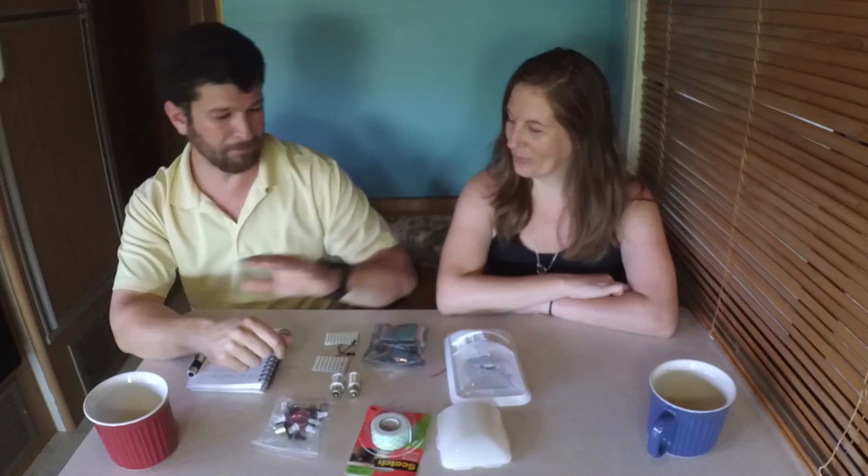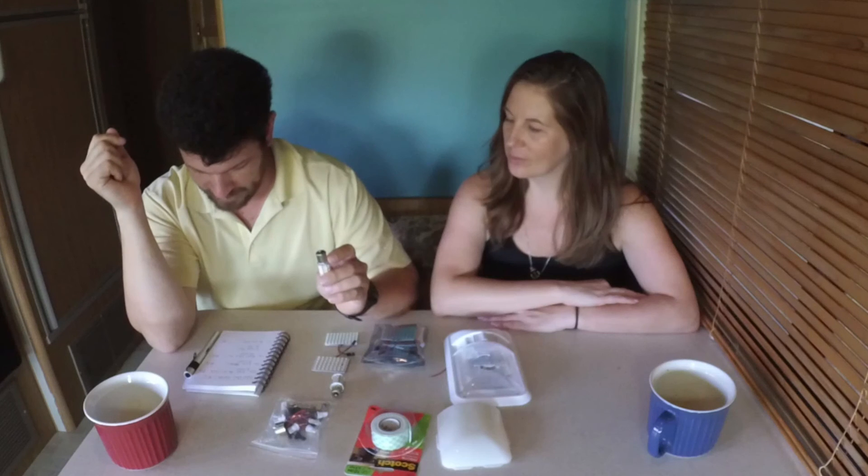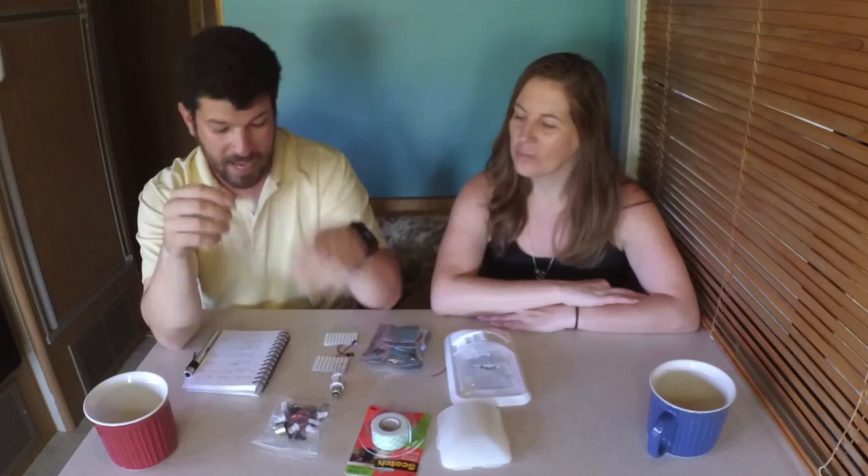Anyways, back to the beginning. When we got Barry, I decided to change up to LED bulbs. Barry's internal roof lighting uses bulbs called a BA15s, also known as an 1156 bulb, which means it's got a single electrode at the end with two posts that lock it in place at the same level. There are some that stagger those posts, and some with two electrodes, so be sure which one you have.